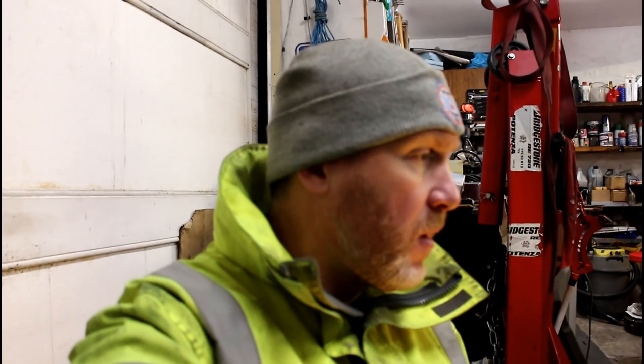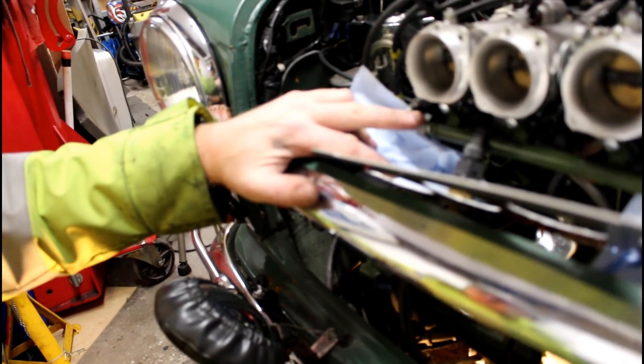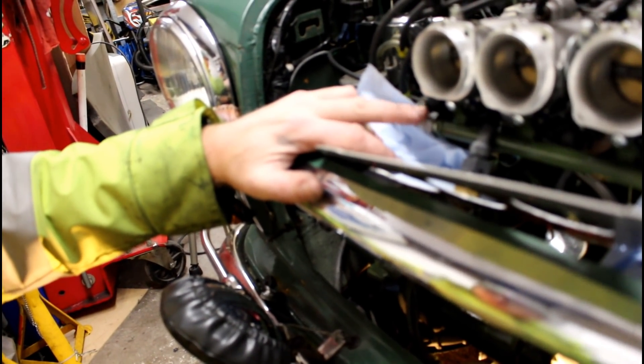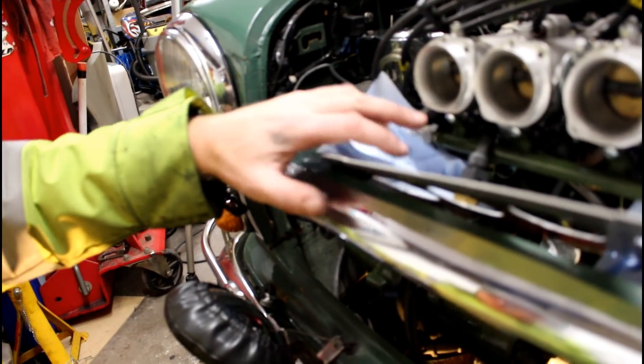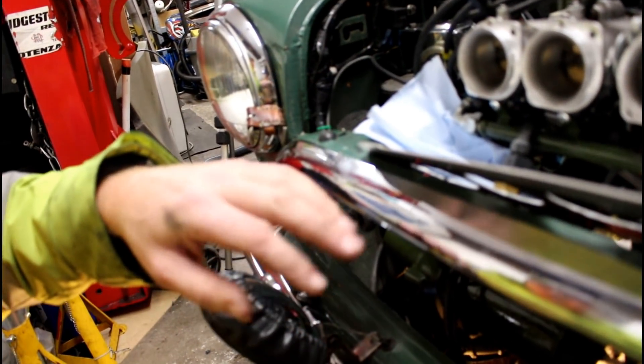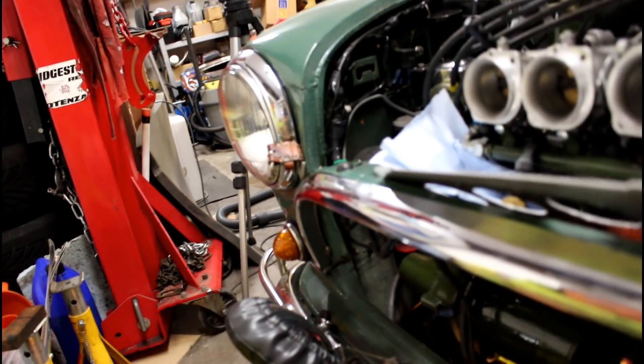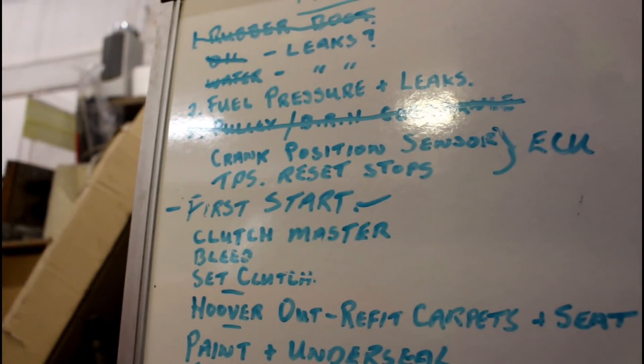There's a lesson to be learned - don't put your air filter back plate on until you've checked for fuel leaks, because in there you can see that that was leaking because it wasn't quite tight enough. The only way to get at it was to take the filter back plate off. So you're better off leaving that off until everything's ready to go and you've checked there's no leaks. Lessons learned. Let's go.